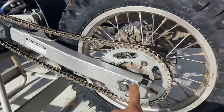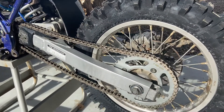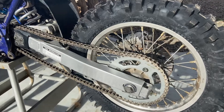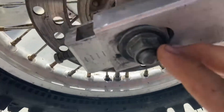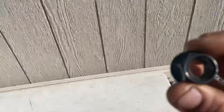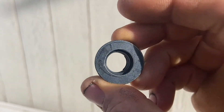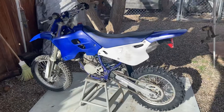When we pulled the rear rim off, the axle bolt was completely rusted — we could barely even get it out. We cleaned it up with some brake cleaner and rags, then threw some grease on it and installed it. The nut is kind of messed up, so I ordered a brand new one from Rocky Mountain ATV — like nine bucks just for that. But yeah, it's coming along and looking a lot better than what it was.